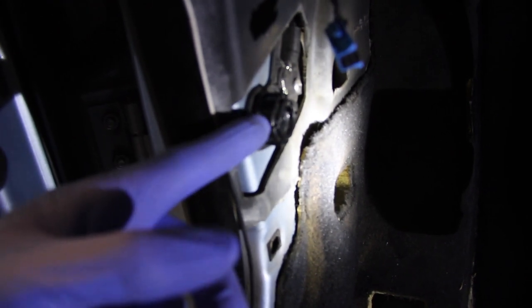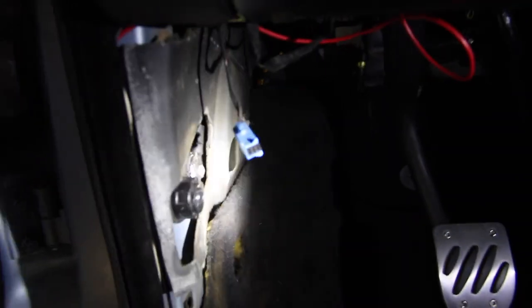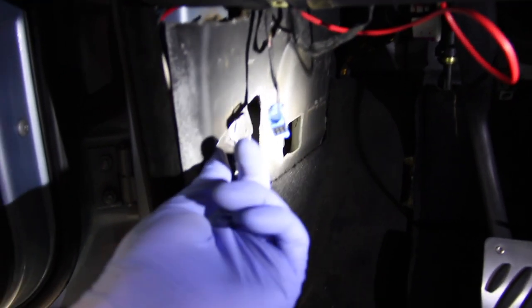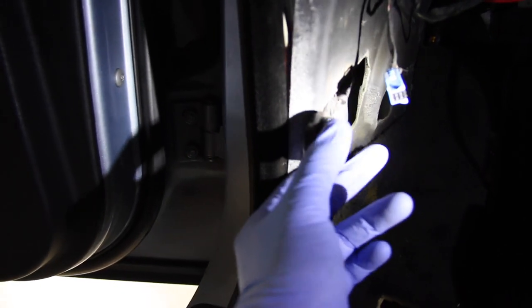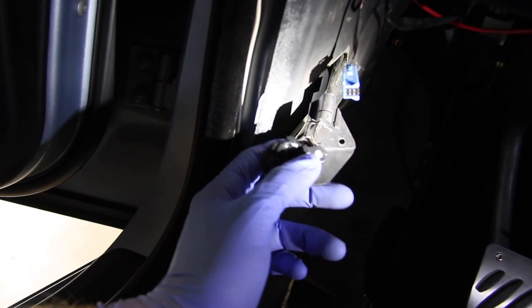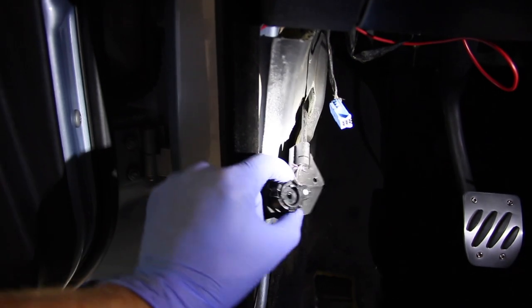This part where the handle connects is part of the cable that connects to the handle. There's a T20 Torx that holds this assembly onto the chassis. When you remove the T20, you take the whole assembly, twist it counter-clockwise looking at it straight on, and it pulls out — it's got keys on the back that rotate into a locking position. That cable is just beyond trashed and frayed, and that's exactly what happened last time because this is where it articulates nearly 90 degrees every time you pull the handle. This is where the majority of the stress is.